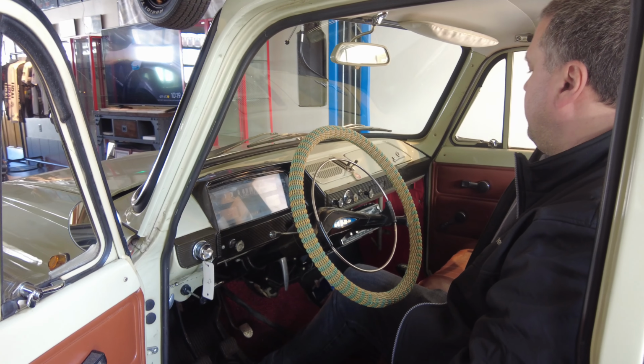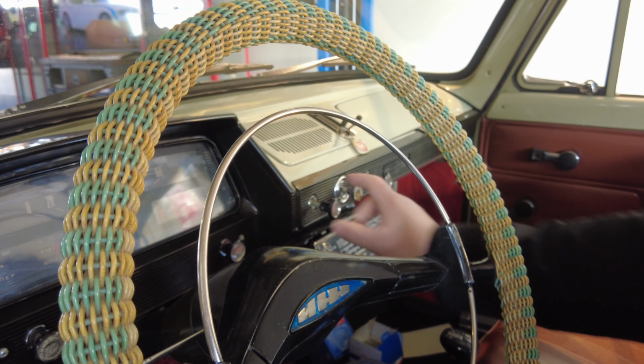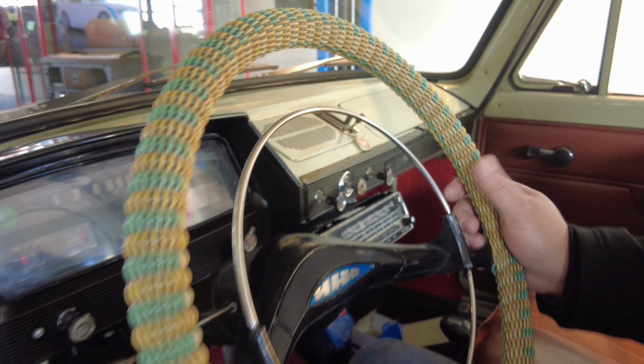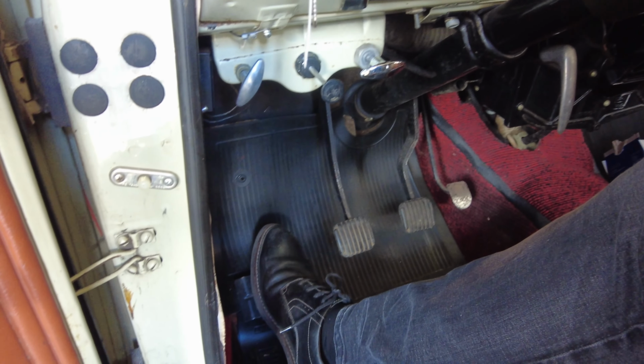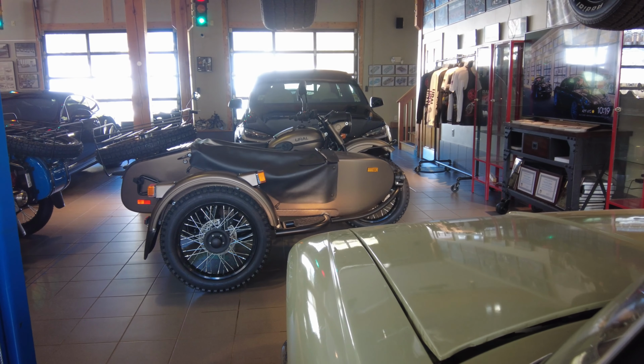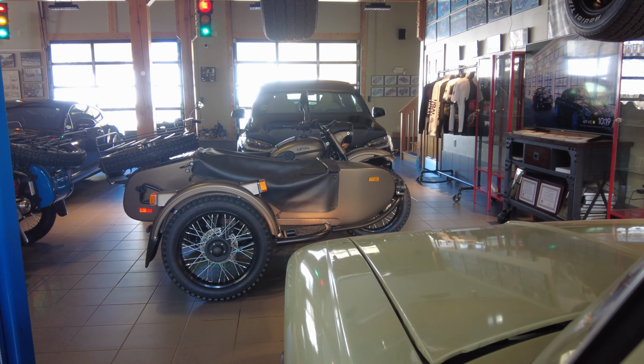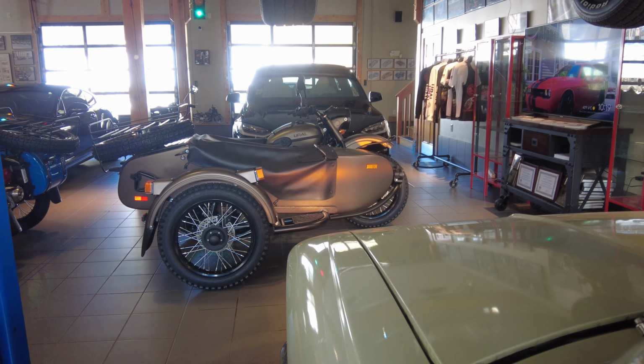So the other controls over here, this is the light. This is the running light. This is the headlights. For low beam, high beam operation, the switch, we press it once, it's gonna be a high beam. Press it one more time, it's gonna toggle to low beam. High, low. So over here, we've got the switch for fog lamps, right here. I can turn it off at this point.